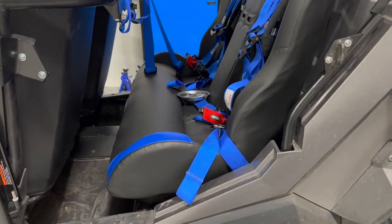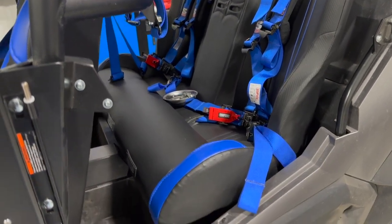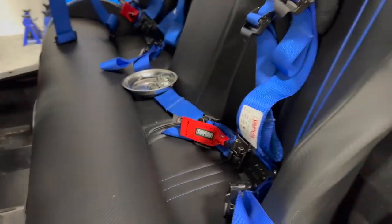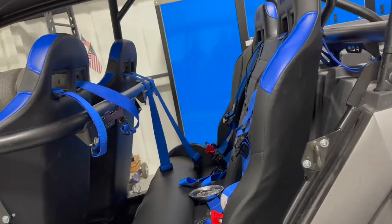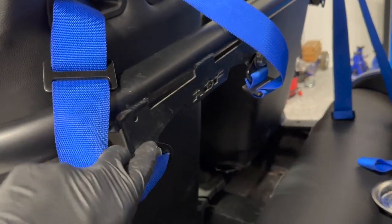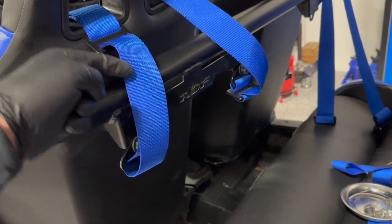The seats were kind of a hassle to get to fit right. The bench seat in the back is more effort than I expected — you have to get both bases to line up just right with a lot of adjustment. You have to lace the harnesses through the center before you can bolt them down, and then you can set the seat in — so they're kind of tethered now. Currently I'm routing the shoulder harnesses through the eyelets and I'm not really sure I like the way this is done. It's just three inches of metal hanging down right in front of the passenger — people are going to hit their knee on that. I'd rather just wrap the harness around the bar.